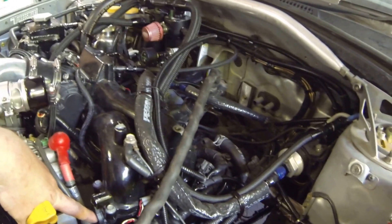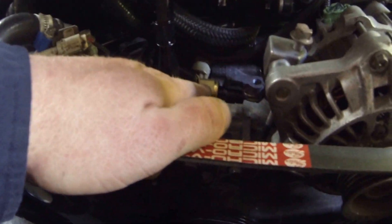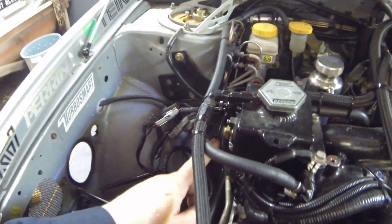I'm using one of the TGV channels — obviously with the TGV deletes that wiring is usable — straight down to the ECU. Over here we have an oil pressure sensor, again using the opposite side TGV wiring. Additional coolant temp sensors, and there's an intake air temperature sensor screwed right into the back of the plenum. All these go into the ECU to help it function.